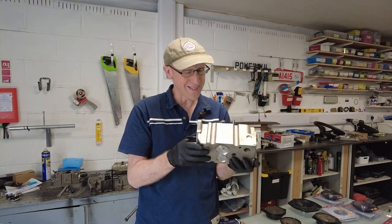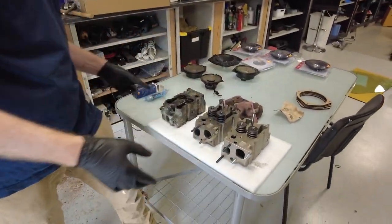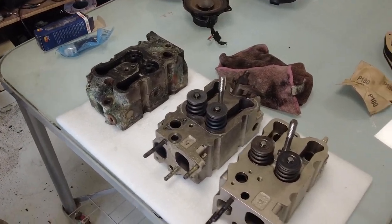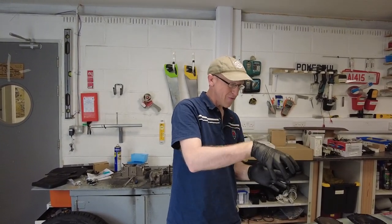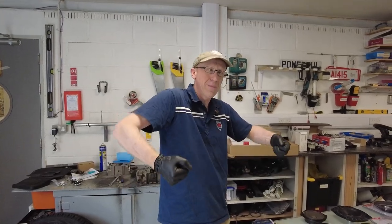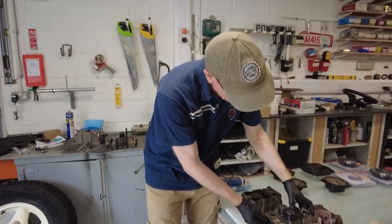In this video we'll look at the differences between the cylinder heads and the injectors, what you have to do to convert to this later, more robust cylinder head. We'll also strip down a cylinder head and take the valves off. I do like these VM engines — the individual cylinder heads make it really easy to just take them off.